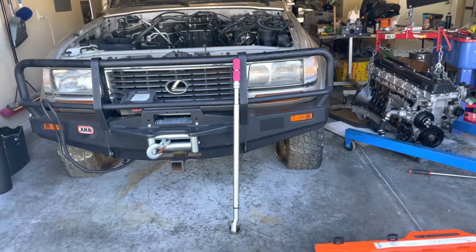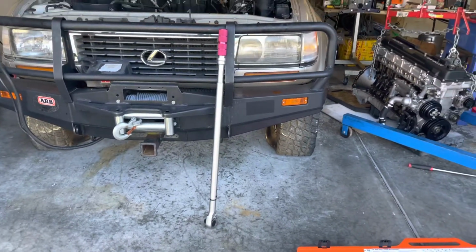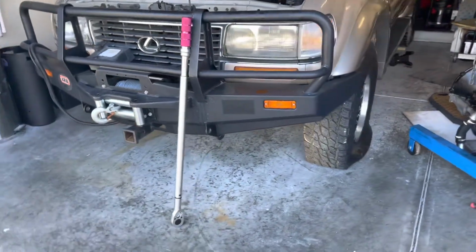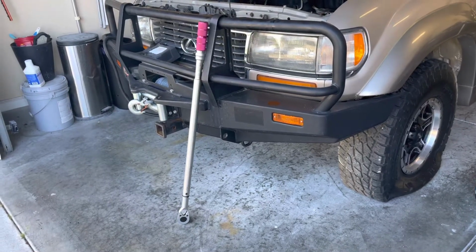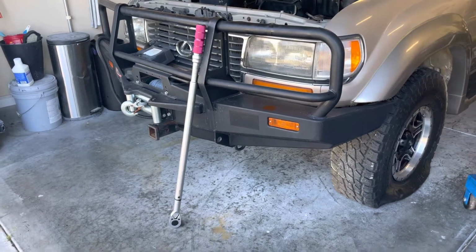That's how tall it is. It's a big wrench, which is cool because I got the right tool for the job. Guys, I only weigh 150 pounds, and I got to torque this bolt to 304, which means I got to multiply my force enough to get to that, because it doesn't matter how strong I am.